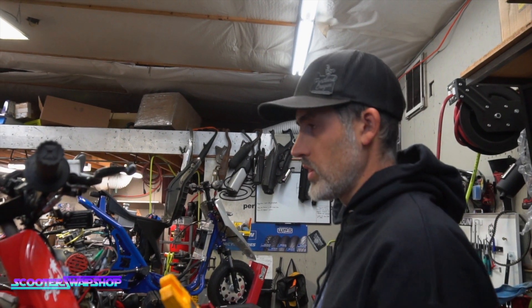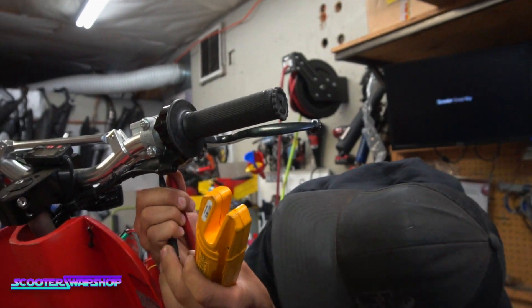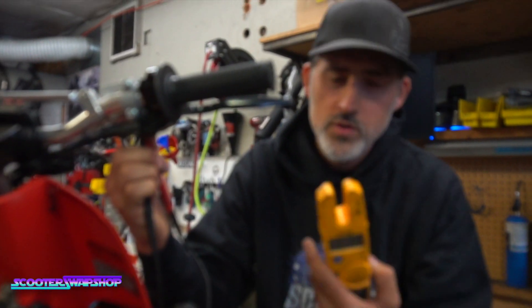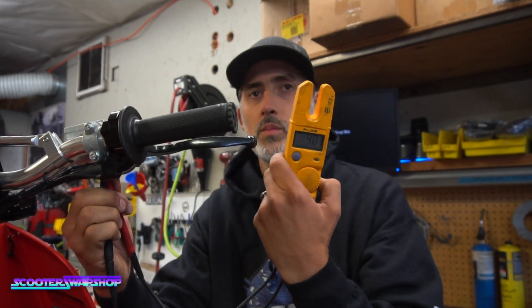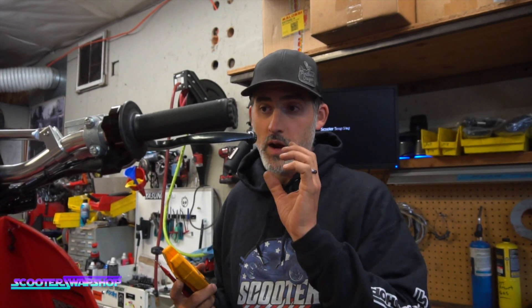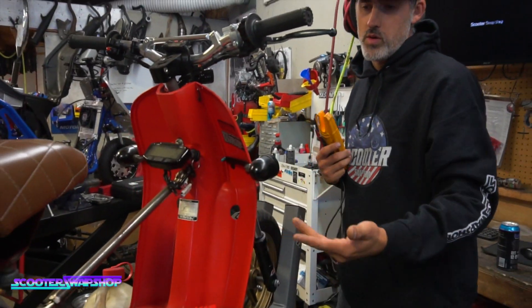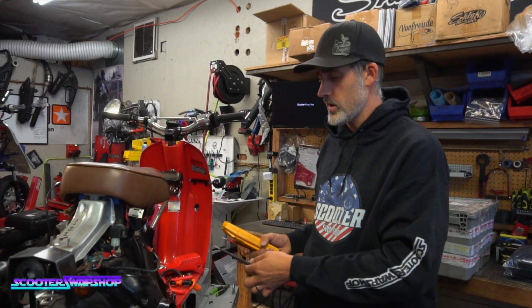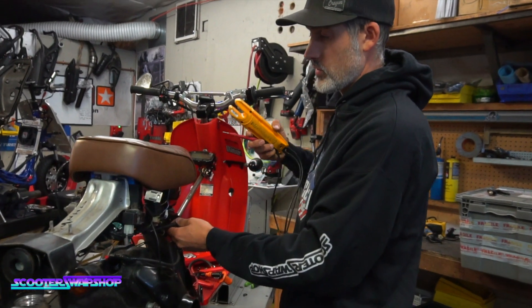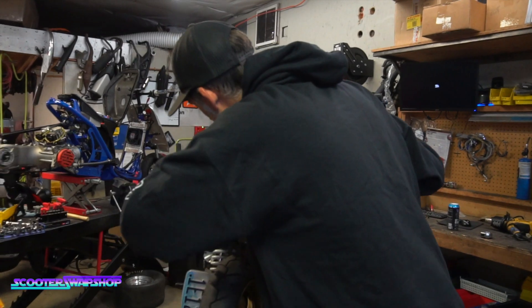Come up here and put my two wires on my brake switch. See — his brake switch is on all the time. It should disconnect and connect when I'm doing this, and it's on all the time. Really nice for diagnosing things. If you've got a coil and you're not getting a spark, pop off your green wire off your coil here, plug it into the green wire to your ground — shows you that you have continuity to your ground.